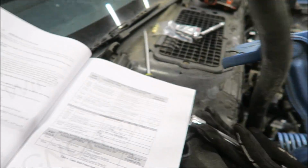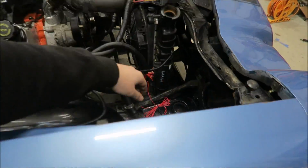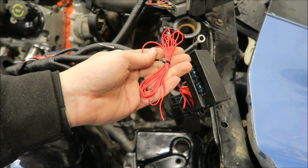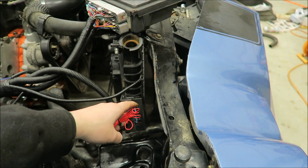This one doesn't have the fuel pump wires, so the next one is this red wire, and this needs to be hooked to keyed power that stays 12 volt when cranking. So we had this problem with Dustin's Cadillac because we kept finding wires that were turned on with the key, but when we'd crank it, it would lose 12 volts. It would drop to like 6 or whatever.